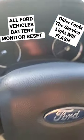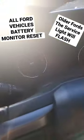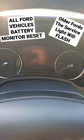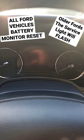We're in a 2021 platinum Expedition, and there are some battery codes that have been present since the customer received it brand new. It was sitting on a lot for a few months and every couple weeks it will set low voltage codes. The battery and everything tests out fine, but nobody has reset the BMS.